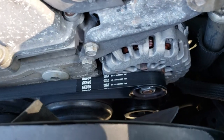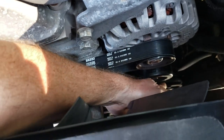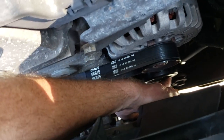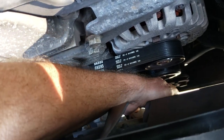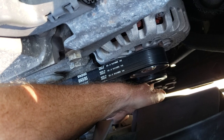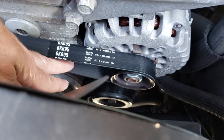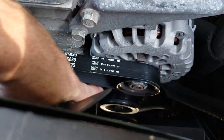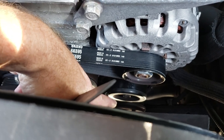This video is specifically going to tell you what to do if your AC compressor has locked up. It's the one way on the bottom here, below your alternator. There's an idler pulley, and then the AC compressor is down here. What you're going to notice on my installation is the new belt is going around the alternator and it is not going to the AC compressor.